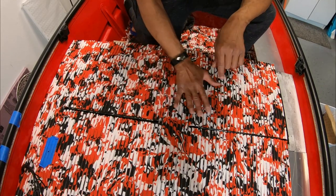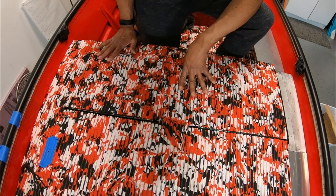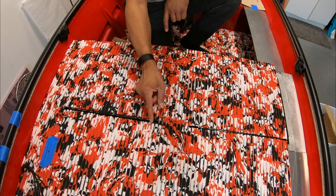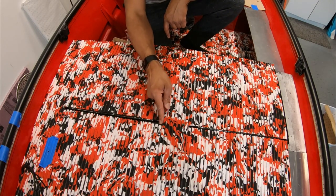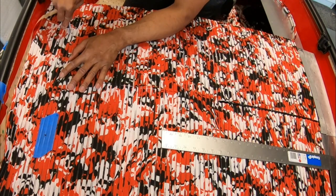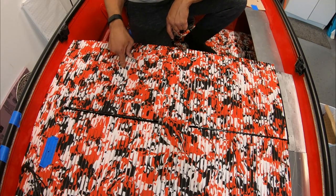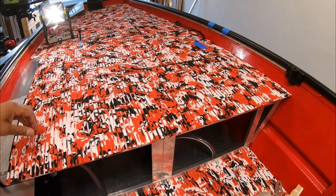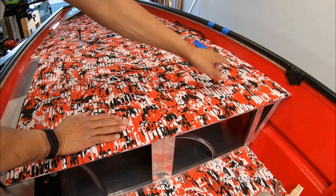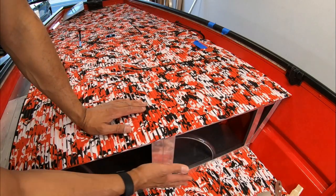What you want to do is lay your main piece down and if you're covering hatches, find your hinges, make your slit down your hinge, trim around the hinge just enough so you can take the pressure off the turf around the hinge and also so you can open your hatch. After trimming around the hinge, the line of the hinge is right in line with the edge of your hatch lid, so you can continue from your hinge and cut straight across to the edge of your lid opening. Keep your blade right down in the groove of your hatch and cut all the way around, then feel out for your latch hole and cut that out. Both hatches can open up now. Next I want to cut off the excess hanging over the side because I've got a panel to install.